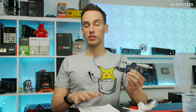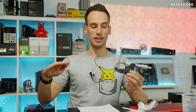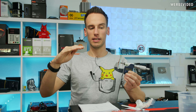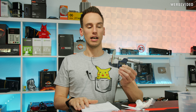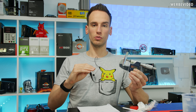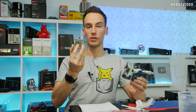After the first lapping run I had about 0.7 millimeter. The reason could be that the chip is usually a little bit convex, so we first start touching in the center and not on the outside of the die — that's why getting the zero 100% precisely is not easy. After measuring after the first run at about 0.7 millimeter, I decided to do a second lapping run and now I'm at about 0.618 millimeter, which is pretty much 0.2 millimeter less than what we had originally.